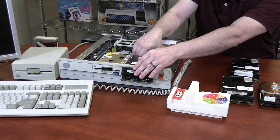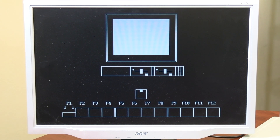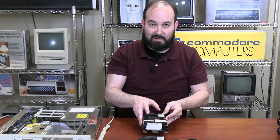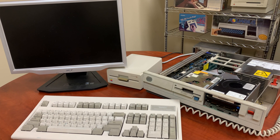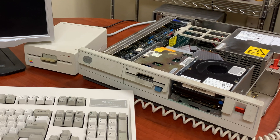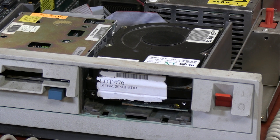Let's take another spin — two. This drive is not even spinning up; there's no physical movement at all. It would seem we're getting progressively worse. We've got one last drive to test — we don't have to spin for it because there's only one left. That drive actually spun itself up and then just spun itself right back down. It just sounds gnarly — got that kind of sound like something scratching against the head surface.